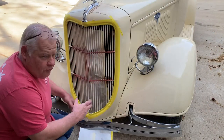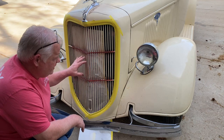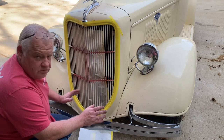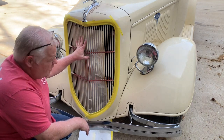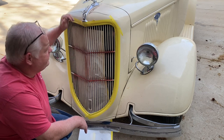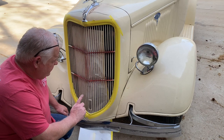Improvement tip number 1472, I don't know. I've got the fans and everything covered up in the back, and I've already primed it a little bit, already scuffed it — it's ready for paint. Probably need to straighten out a few of these teeth, but that'll come another day when I redo this truck if I ever do. What I'm going to do is paint this grill a chocolate brown. It's going to match the pinstriping that I'm leaving on the truck. I'm taking some of the decorative pinstriping off, so I'm going to go ahead and hit it with some primer, get some of the bare metal spots, chips and stuff that I fixed, and then we'll hit it with a brown.